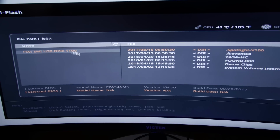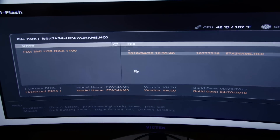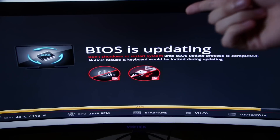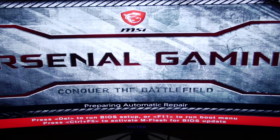You can see here this is our USB drive with the BIOS loaded onto it. According to the date, we know this is the right one — good old 420. Here is our BIOS file. Click it, and it'll ask 'Are you sure you want to select this file?' Click yes — this is a .hc0 file — and your system will update its BIOS. By the way, this process could take a while; it's been running about three or four minutes, so don't freak out. Whatever you do, just as the screen suggests, do not turn your PC off — let it run the entire time. Otherwise you'll have a bricked BIOS and might need either a new chip or an entirely new motherboard. After it finishes flashing, your PC might reboot more than once — just let it power cycle on its own.